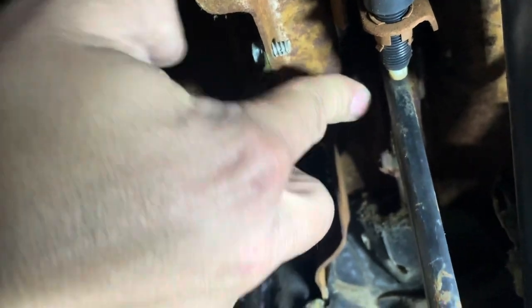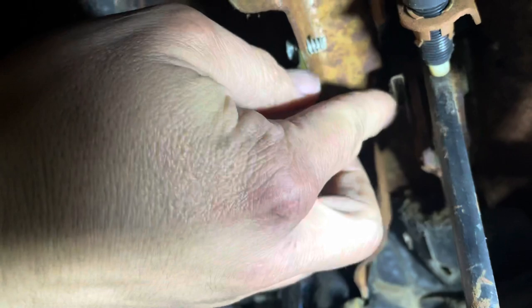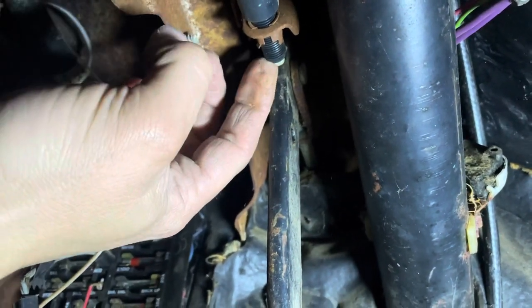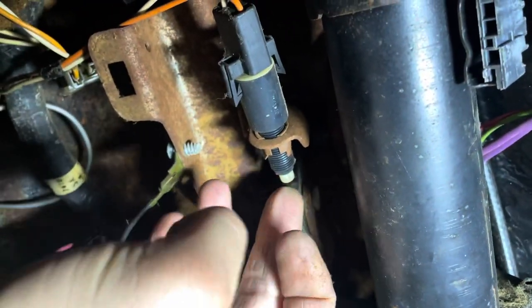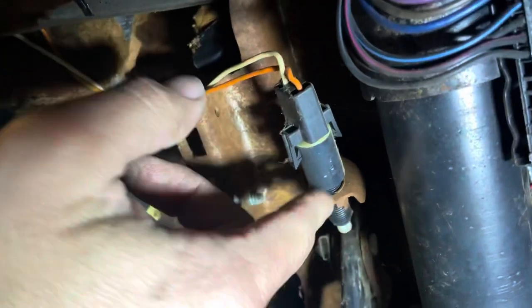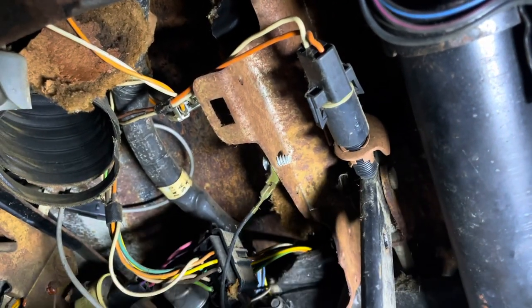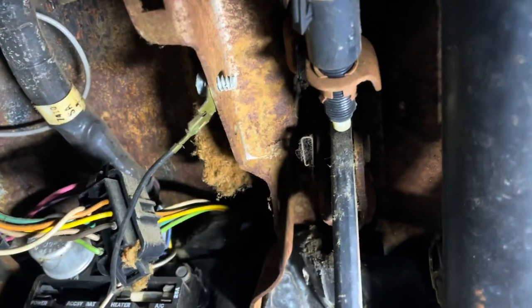Where is it? Here. There's a little spring clip here. Pop that dude off of there, pull this pin out. This right here, for those of you who aren't familiar with cars: push the pedal down, and the rear brake lights come on. When that comes out, let off, it turns the lights off. This car has the brake lights stuck on all the time. That's because there's no hydraulic back pressure pushing that up. So I'll go ahead and see about knocking this thing off.